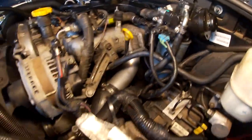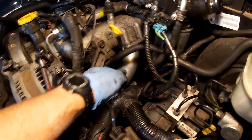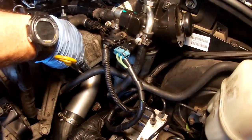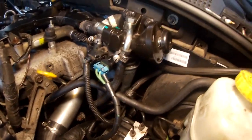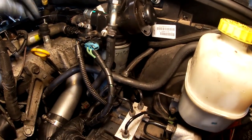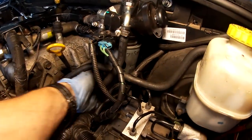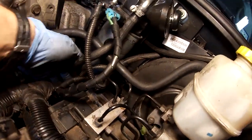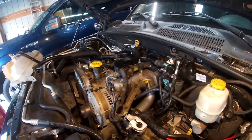Intake tube — I think this side is finished. I've got the intake hose, the tube, everything bolted up. Make sure the dipstick bracket is bolted on tight. The only plugs I have not plugged in are the ones that go to the EGR — I'm going to leave those loose and see what happens. I've got the bottom of the fuel filter plugged in. I'm going to blow this side clean and move to the other side.